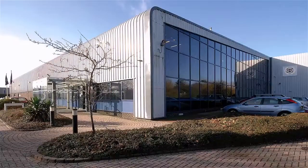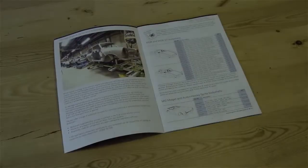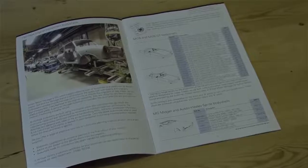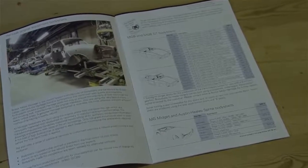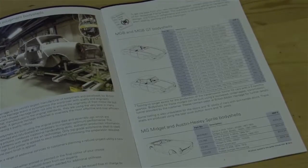British Motor Heritage manufacture 22 different body shells for the MGB — right-hand drive for the UK and Australia, and left-hand drive for Europe and the United States. They are not able to build shells with the early pull-handle doors because that specific tooling no longer exists, and if you want a shell with a narrow transmission tunnel, used from 1962 to 1967, that tunnel must be recovered from an original vehicle, as those pressed dies were never traced. A special variant incorporating mountings to take the MG RV8 suspension is made for both roadster and GT models.